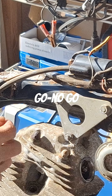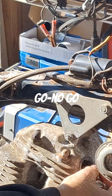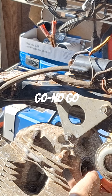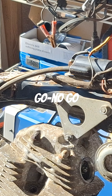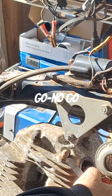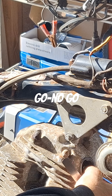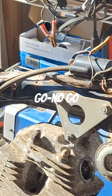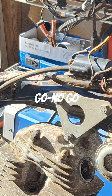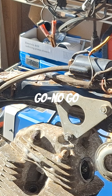This exhaust feels a little looser, so I'm going to check it with the two thousandths gauge. Now we can see the two just slides right in there — fairly loose on that one. So we're going to try a three, see how three does in there. Actually, I'll try two and a half first since it does feel looser.